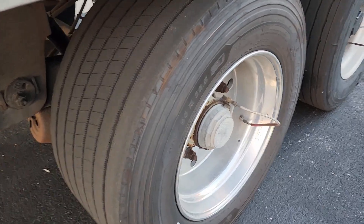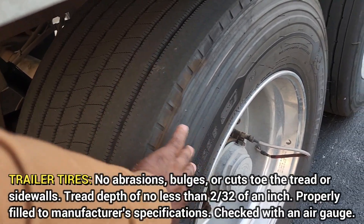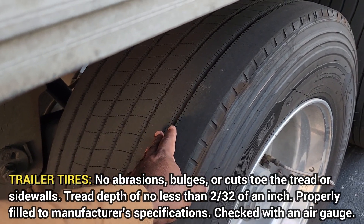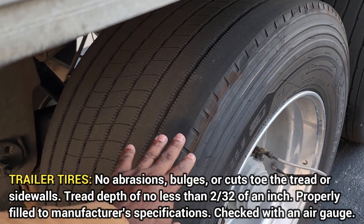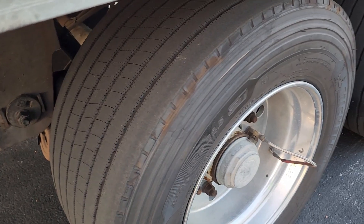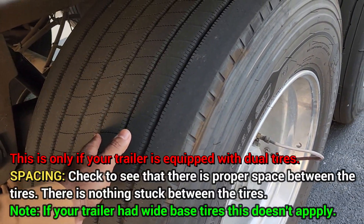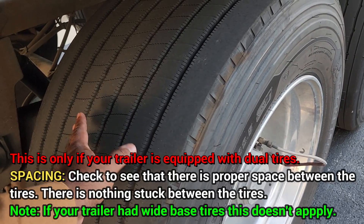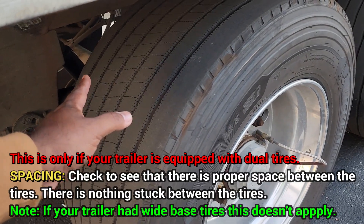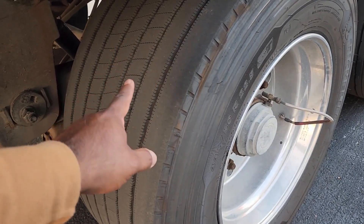We're going to step out and look at the tires. Make sure there's no abrasion, bulges, or cuts to the tread or the sidewall. Tread depth no less than two thirty-seconds of an inch. Properly filled to manufacturer specification — I will check that with an air gauge. Also, spacing: if you have duals, check to see that there's proper space between the tires and nothing stuck in between them. This only applies if your trailer is equipped with dual tires; if your trailer has wide base tires, this does not apply to you.